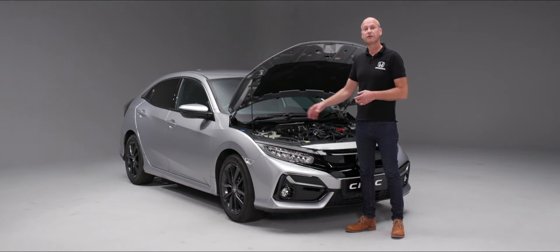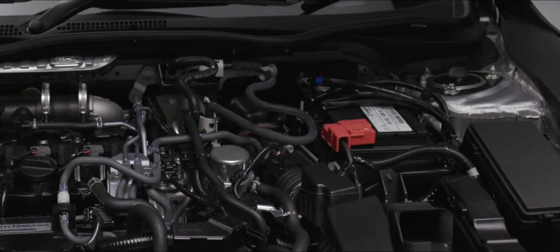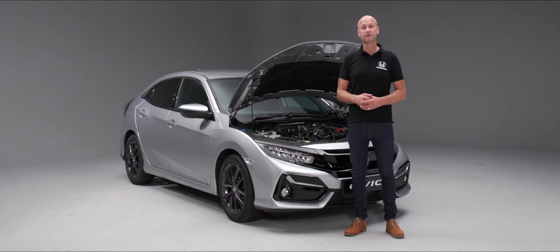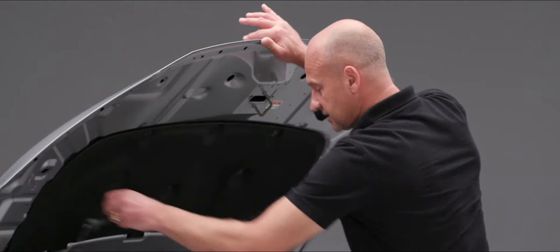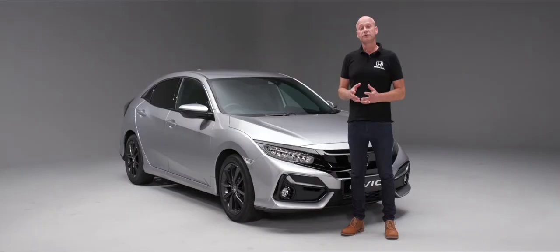The coolant of course you would check when the engine is cold. We do have a 12-volt battery just on the right-hand side of the vehicle. Once you've checked the fluid levels under the bonnet and topped those up with the appropriate fluids, we need to close the bonnet — take out the bonnet stay, click it into place, and the best way to close the bonnet is from a relatively shallow height, just let it close under its own weight.